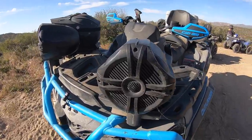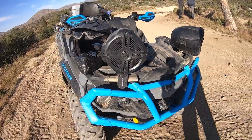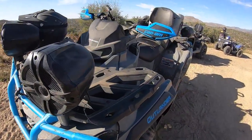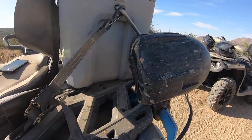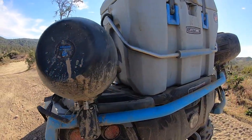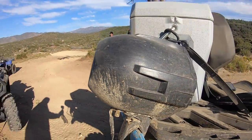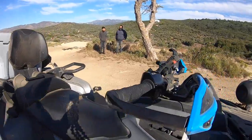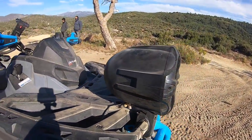I will say these six and a half inch tower speakers have a good amount of bass. Now I have very little to complain about the system, but here are some things that can be improved upon. The speaker connections do not work the best, specifically on the rear speakers. I think it's because mud slings onto the flex pin connectors, making the wiring brittle and eventually breaking off from so much bouncing around on the trails. I wish they were RCA connections or at least an alternative that would provide a better solution to this problem.